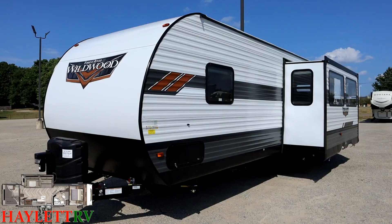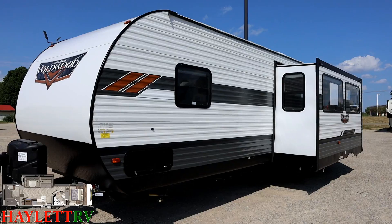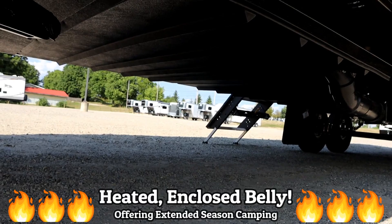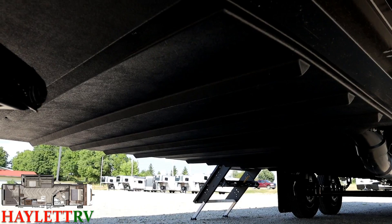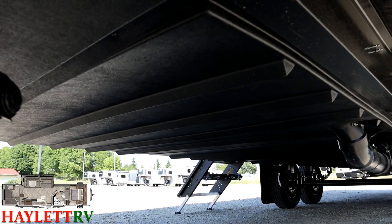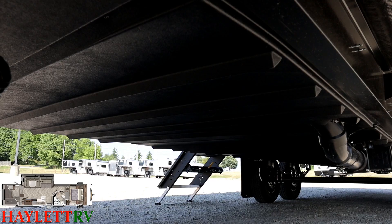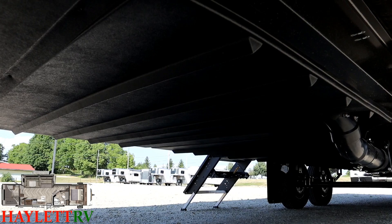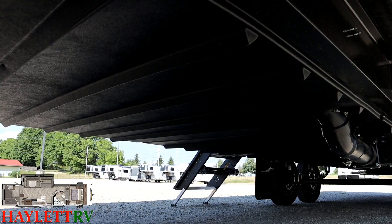We have magnet holdbacks on all the exterior baggage doors to make life simple and easy for you. And Wildwood does have that sectionalized, heated, enclosed underbelly. And I love that — the cool thing is this is not like new. This is proven stuff here. Instead of that plastic corrugated belly material that everybody seems to have, or the honeycomb thermal pocketed stuff, this is four-by-eight sheets of molded, removable plastic. So if you need to drop a panel to service it, you can do that without having to tape a Stanley knife and cut a hole in your underbelly enclosure and then basically duct tape it back up when you're done — that's about the only way to do some small-scale service on a normal underbelly.